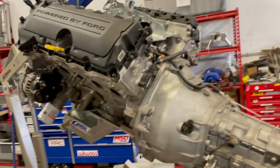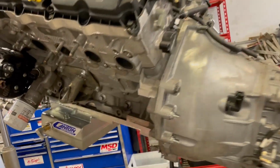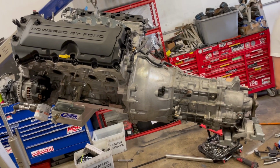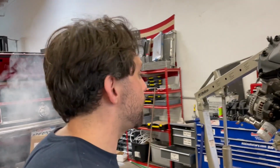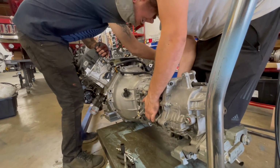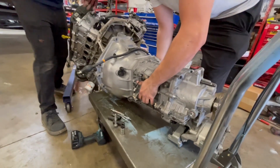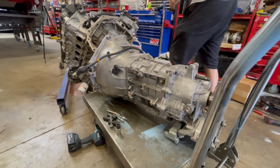So, yeah, like you said, something with the pickup. It just doesn't have a pickup. Oh, it's got no pickup. There's currently no oil pickup in the oil pan whatsoever. This is a non-functional thing. If you tried to turn it on, it would detonate itself. It'd turn on probably, but it wouldn't turn on for long. Doing the thing that nobody wants you to do, but everybody always does. Pretty much. Oh, God! One way to get the rest of the coolant out.